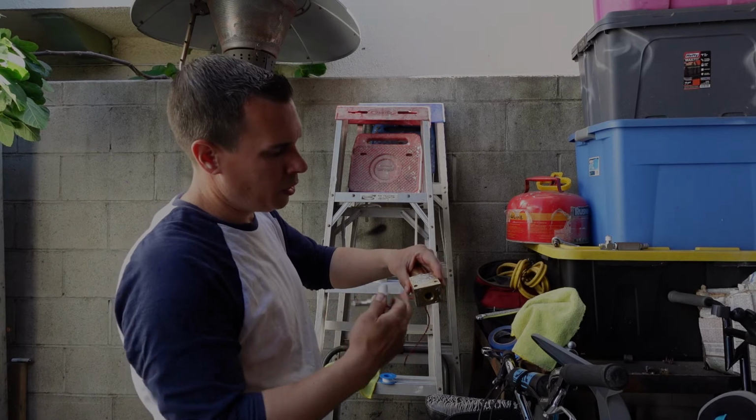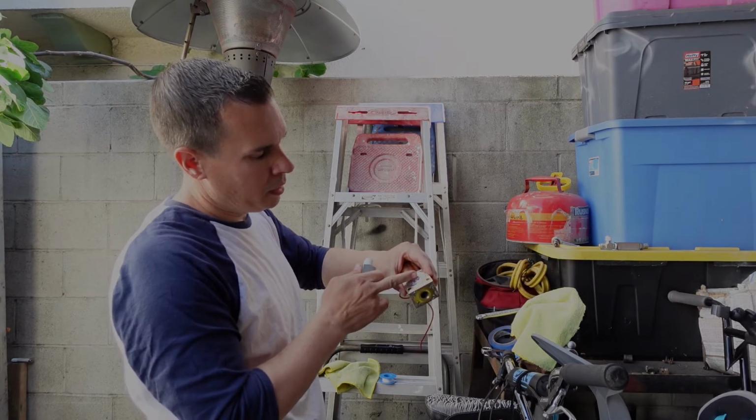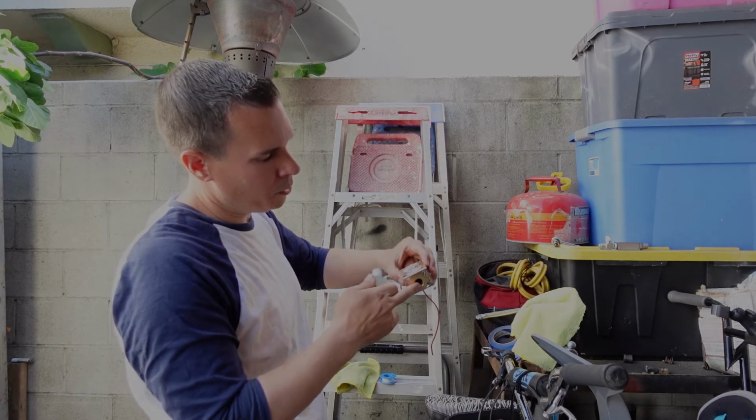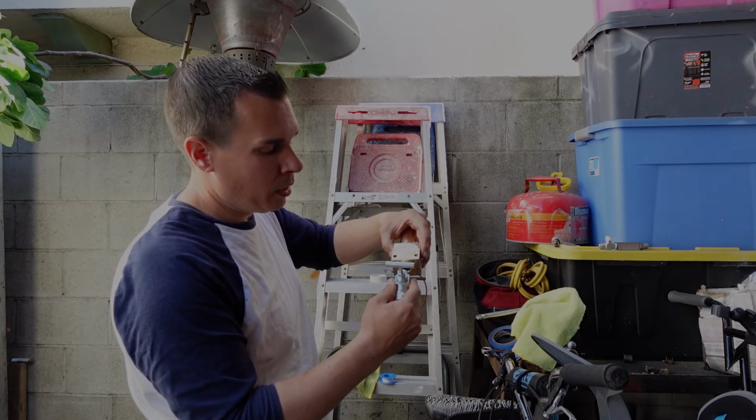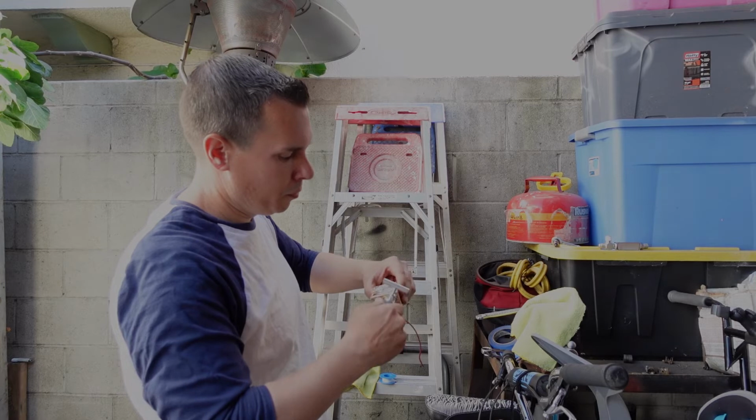Basically, you have your pressure set going this way, dump normally closed, and then when you open it, you return. So basically, I'm putting my slowdown right on the bottom side of the dump.